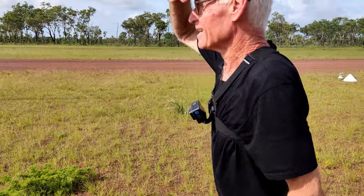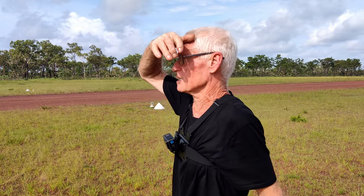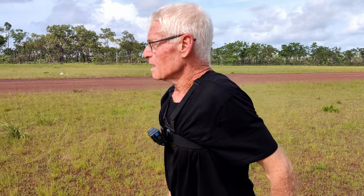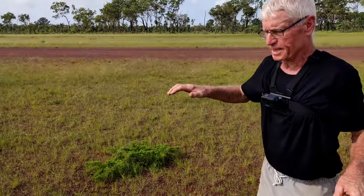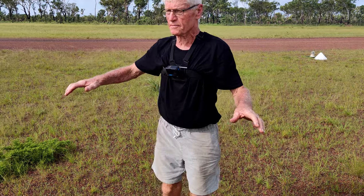I didn't notice, but it looked like you were putting a lot of rudder. Was that just the crosswind? Probably, yeah. How's it performing? It's got a really bad shake, a slow RPM shake when it's just leaving the ground. Then when it gets into the cruise, the shake all goes away.